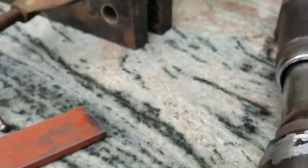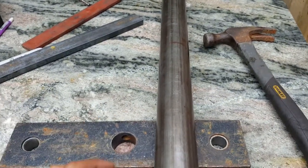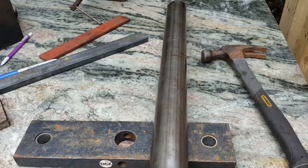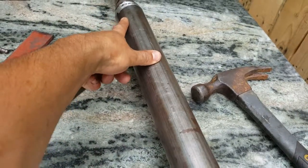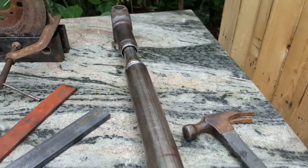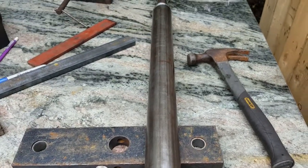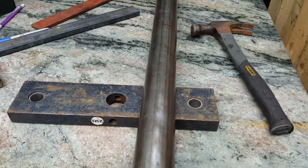There are the welds - just ground off a little bit but they're pretty good. Even if your welds are not great, this will still hold because the original weld is still there. You're not too confident about your welding? You could actually get away with this without welding. You could just drill a hole and put a bolt through it. You could actually do this driveshaft using only a pipe cutter, a hammer, and a block of wood.